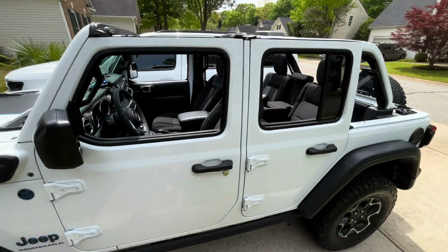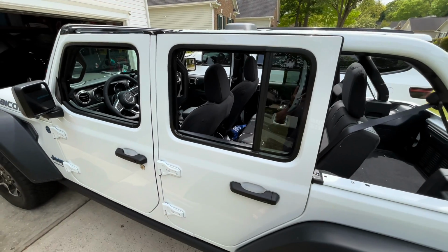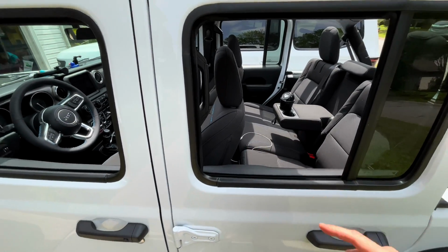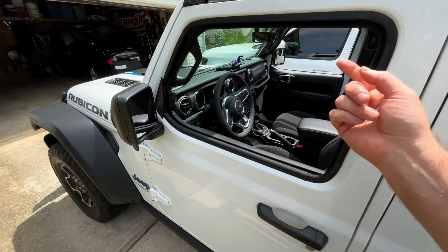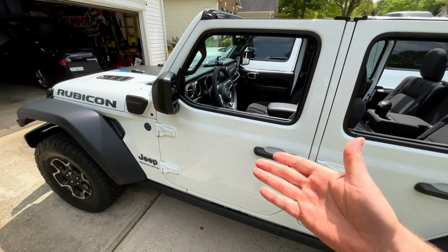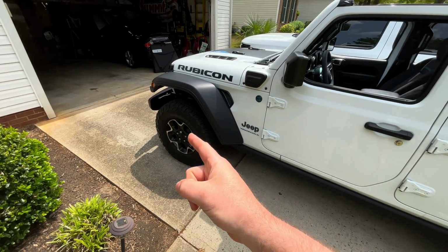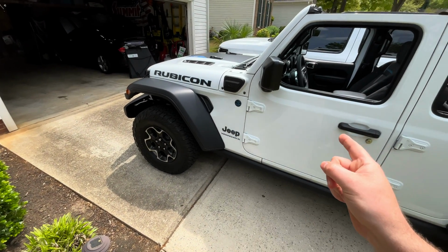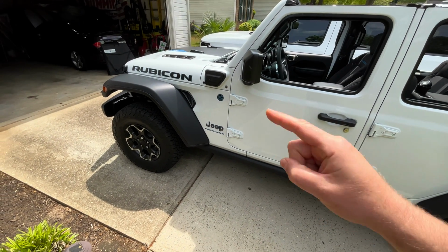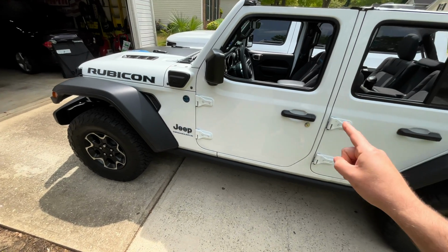So that's how the system's designed to work. It feels very flawless. The only thing you do notice is the shifting of the transmission. You don't really notice the brakes switching from hydraulic to generator, other than when you have the Max Regen on, as we demonstrated in the video earlier. So hopefully that answers some questions for those of you out there who didn't understand how the regenerative braking works and how the brakes aren't actually putting power back into the battery in the vehicle. It's actually the motor regenerating, acting like essentially an alternator, putting the power back into the battery.